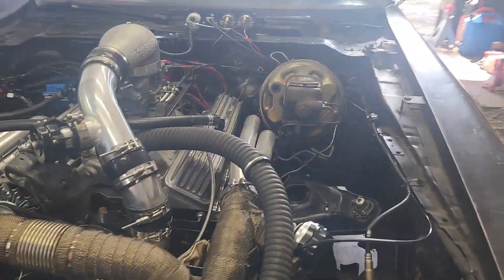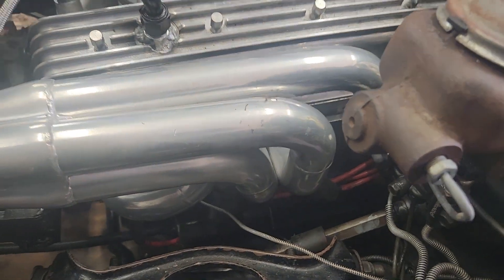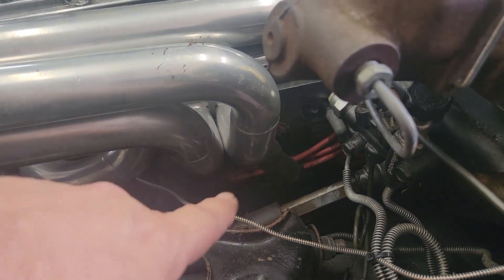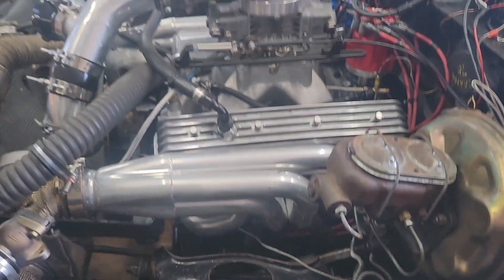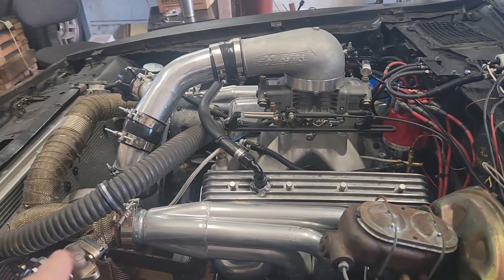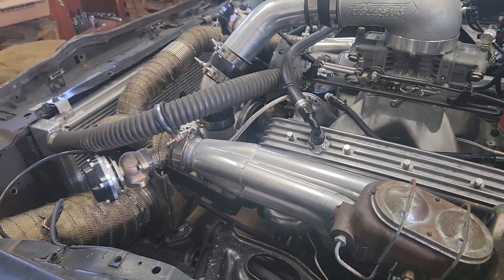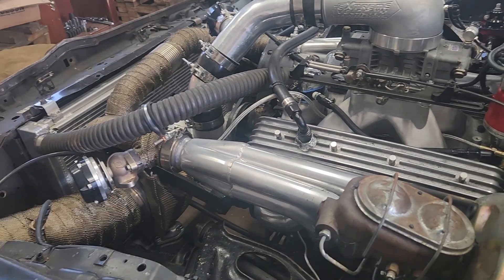On this one we raised the motor up, took the oil pan off, and put a bung in the oil pan because the way we had the oil drain running it wasn't going downhill enough — the turbo was smoking. I thought that was causing it to smoke, so I took the pan off and put a bung in. It's more downhill now but it still smokes. I think this one has too much crankcase pressure. We might have to get a pump — some people mount their turbo so low that oil can't drain by gravity, so they use a pump. That's probably what we're going to have to do.